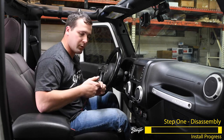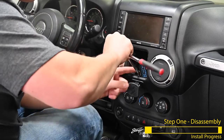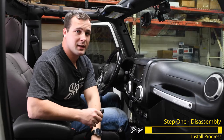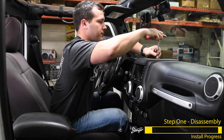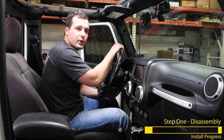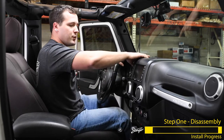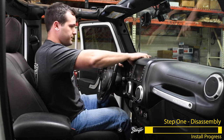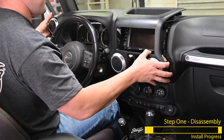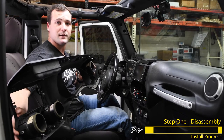There's another 7mm bolt right behind that. Now we need to remove the rubber insert in this top pocket — there's another 7mm bolt underneath that. Now we want to lower the steering wheel down to its lowest position, lock it in place, and we can remove the entire dash bezel. You can do that by simply grabbing the pocket and giving it a little tug. Set that in a safe spot on the counter or in the back seat.